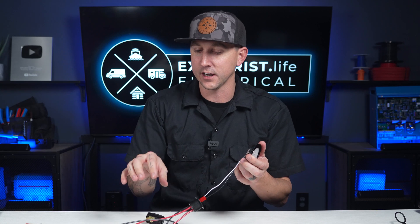That's pretty much all there is to know about these Anderson connectors, and more specifically why you may want to connect one to a switch and one to constant power — it's just so you can have that modularity and flexibility in your circuits. In the next video, I'm going to step away from Anderson connectors and teach you how to tap into a different circuit, specifically a headlight circuit for powering a relay for off-road lighting or something like that. Click up here to watch and I'll see you over there.